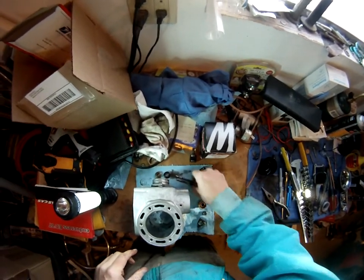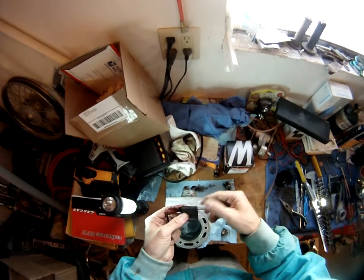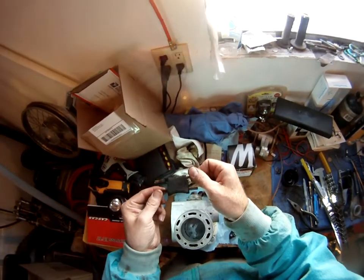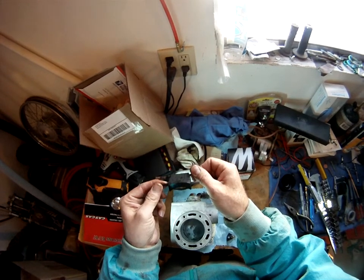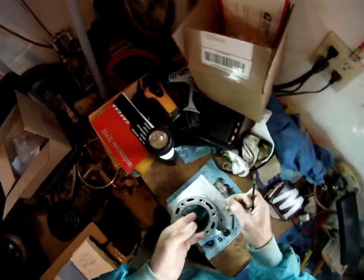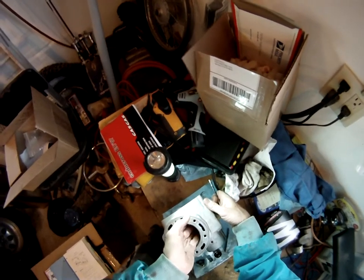Got two rods that hold this power valve flapper. The long one goes in the front, short one goes in the back like so. The long one holds it stationary, though it's the rear one that moves up and down when the power valve is closed. When it opens and rotates up, it holds the power valve open. So we'll go ahead and put the long rod in the front - if you get the long rod in the back it just won't go together, so you'll figure it out pretty quick.